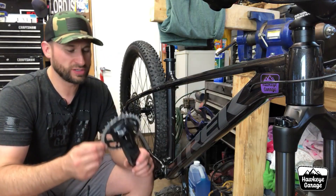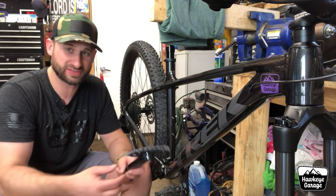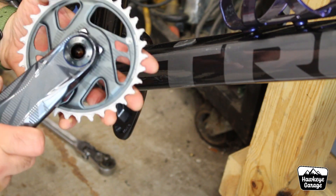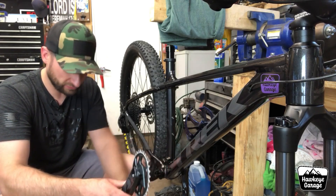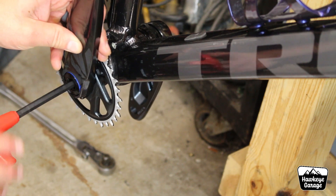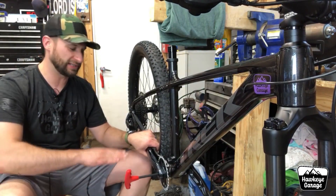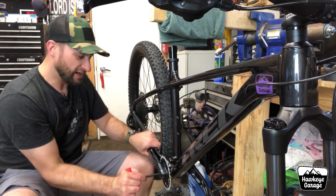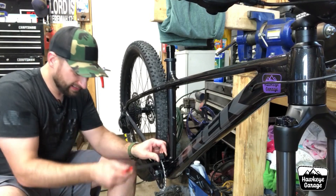This comes with a 32 tooth round chain ring. My stock SX one had a 30 tooth round chain ring and I was going to swap them out just to keep the gearing kind of the same. Until I took them apart and realized how much lighter this chain ring was — so I'm going to run this one and see how I like it. I will probably end up going oval in the future; I've run oval before and I really like them. So let's go ahead and put this on with an 8mm Allen. That is buttery smooth — that is so nice. And it is installed.